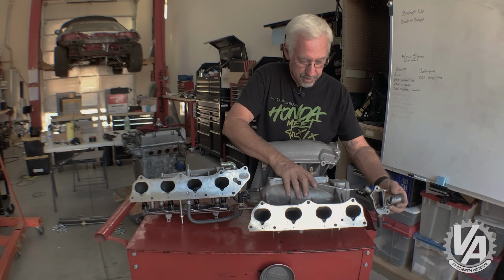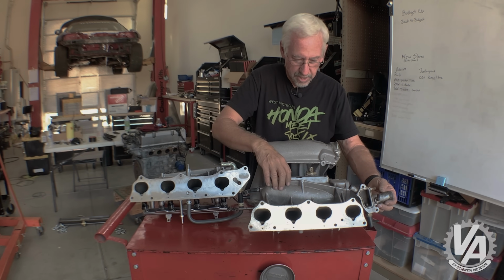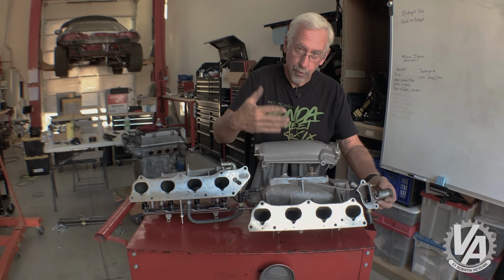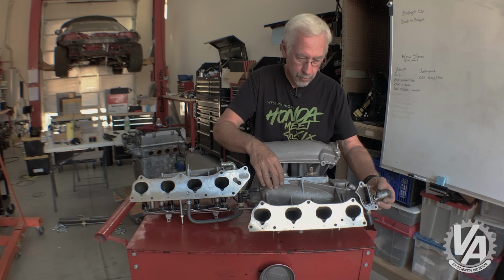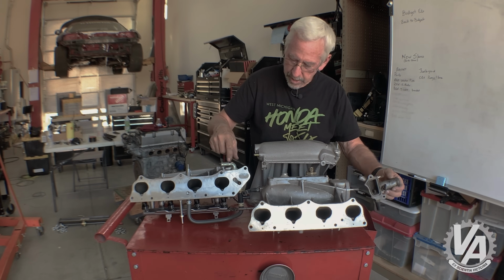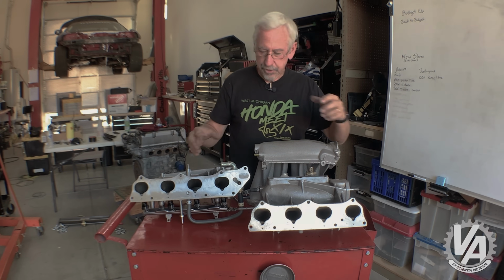Normally, there is this piece right here that has the hose that leads to the backside of the thermostat valve, so water circulates in the engine before the thermostat opens up. It keeps the head cool, but that's how this normally works. So we need to have this on this. So we have a solution for that.